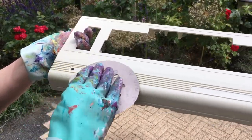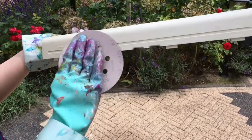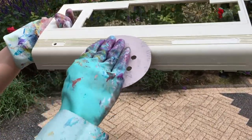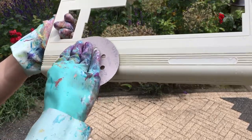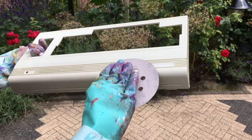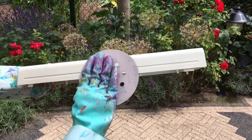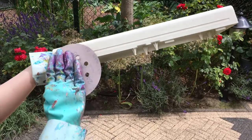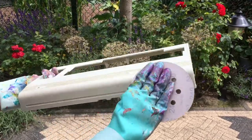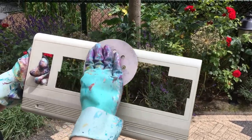Number one, retrobriting probably increases the brittleness of old plastics, which are already very dried up, very brittle. So you actually make that worse. But even more importantly, it is not a permanent solution. Within 6 months, a year, a couple of years max, if you're lucky, the plastics will start to yellow again. This particular case is not very yellow, but it will be.